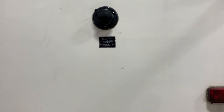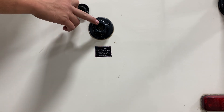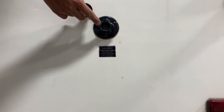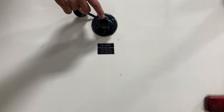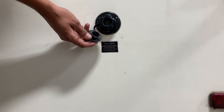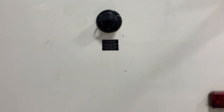Right up from there we do have your black tank flush. Thread in a garden hose while your black tank is hooked up, open up your black tank, and turn on your water. This is going to flush out any debris hanging from the probes — if you've got an issue where your board is saying it's full and it's not, this helps with that. It also helps with getting rid of any smells.